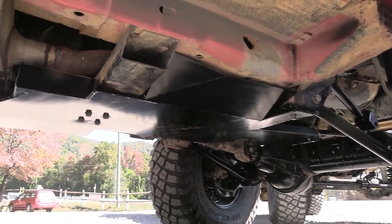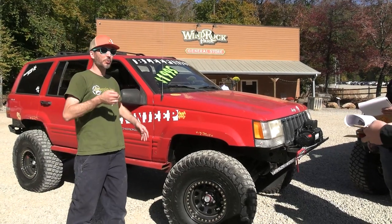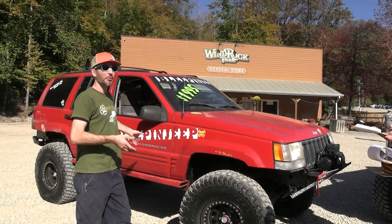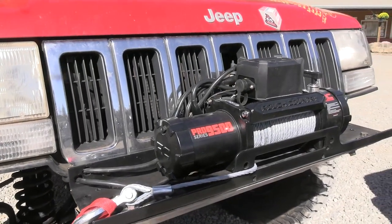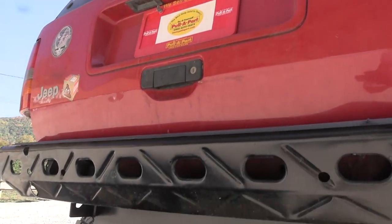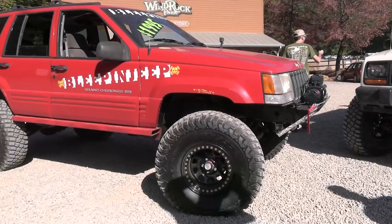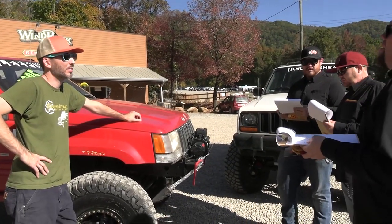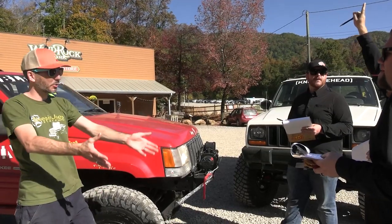The front springs I found on Facebook — they were way too high so I had to cut those down about 2 inches. The rear springs were brand new but on sale. I also had to cut those as well because the front springs were about 10 inches of lift, the rear springs were about 8 inches, and when I got them on there it was just ridiculous. I have a front winch from Rough Country, a winch plate, and a skid because the radiator on the Grand Cherokee is ridiculously low. This front axle is high pinion and it also has chromoly axle shafts and CTM joints — so it was already upgraded when you bought it.